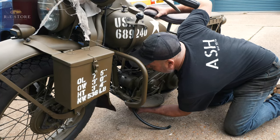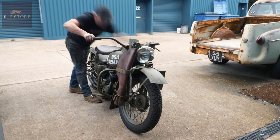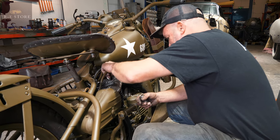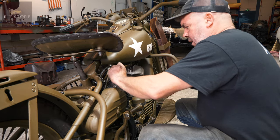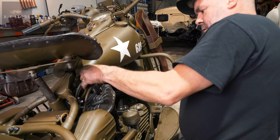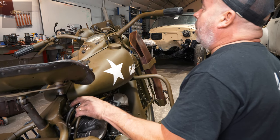What do you think's happening then? It's probably just where everything's so dry. So what's your diagnosis for getting it going? Well, just need to make sure it's getting fuel first, which I think it probably is. Should have more than enough oil around there to get the suction up. What would be the reason for that? Lack of suction. So we'll give it a bit of WD-40 down the bores, give it a kick over.